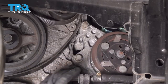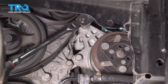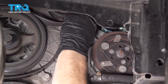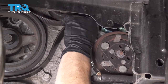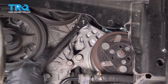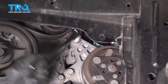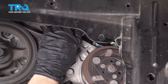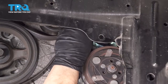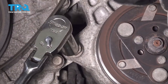Now we're back in the passenger fender well and you can see the compressor. There are two mounting mechanisms — one is a bolt and one is a nut, 15 millimeter socket. I'm going to take the nut off first because we need to take that stud completely out — that's why they put an inverted Torx head on it. I'll loosen it up before the weight of the compressor is on it. That inverted socket is an E8 — an inverted star like a Torx. Last mounting bolt is right here, 15 millimeter socket.